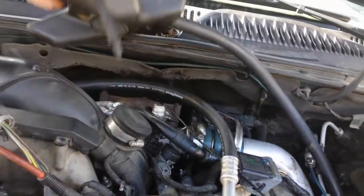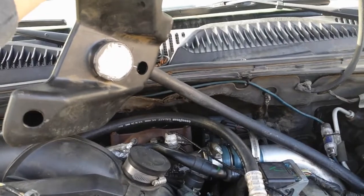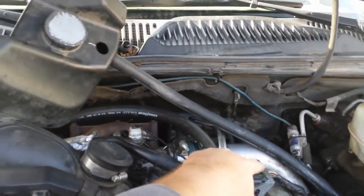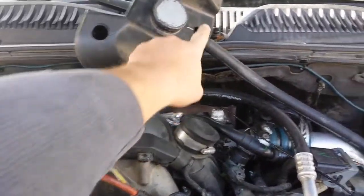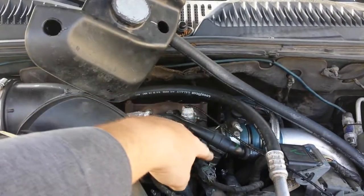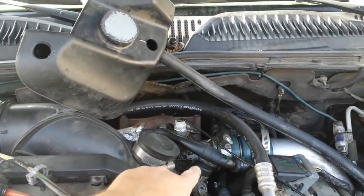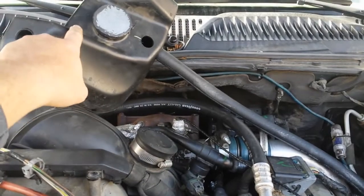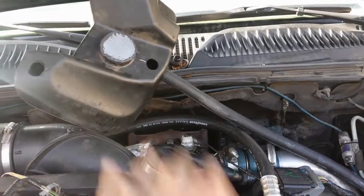I've already got it capped off at the bottom and I've drilled some holes. This is going to be PCV from this side, this is going to be PCV from the passenger side, and then this is the outlet going into the intake. The difference is the air can flow into the intake but the oil stays in the catch can. So you get the PCV working as it should without all the oil.